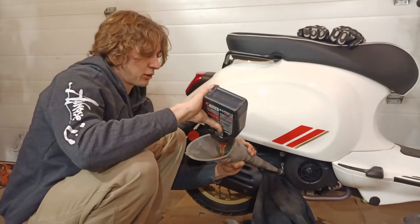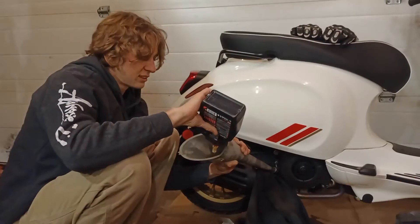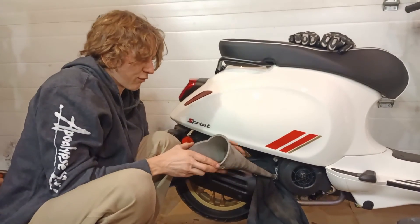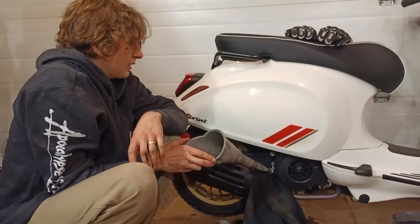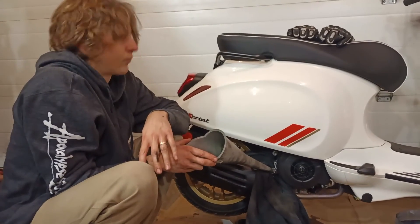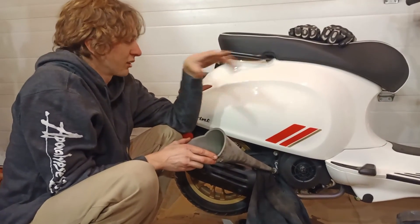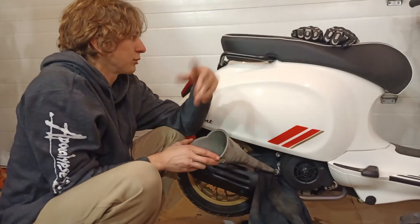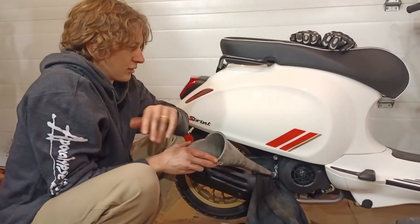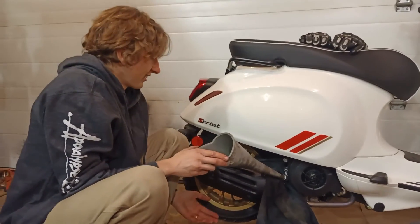After you fill your bike with oil, you're going to want to start it. Let it run for about three minutes, let it sit for five minutes, and check the oil. You've got to start it to see the correct oil level because it's going to fill up the oil filter, and then let it sit so the oil can settle back down into the pan. This bike has an oil pressure light — it's probably going to come on for about five seconds when the bike first starts because the oil filter will be filling with fresh oil, but then it should go out. If it doesn't go out after 30 seconds you should stop, but if you put oil in it, it'll go away.